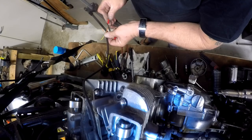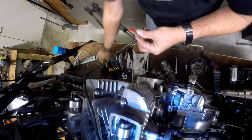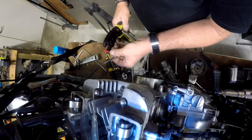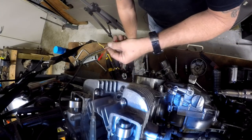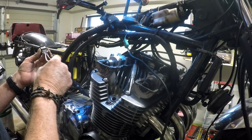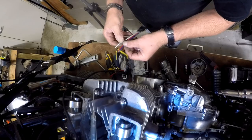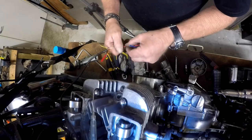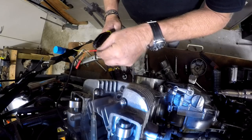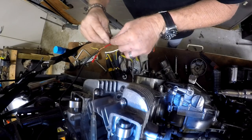What I'm going to do here is something really dodgy for now just to keep us going. What I've got here is a hazard light switch — it's latching. I bought a packet of three or four of these; I fitted one to my wife's scooter. We can just pick any two wires and poke them in here and we should have a switch we can use temporarily. Not sure what the amperage rating is on it, but this is a 10 amp setup so I can't imagine it would be any more than that.